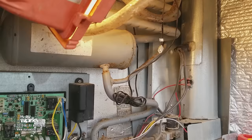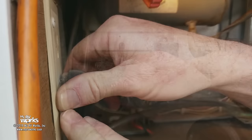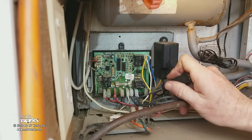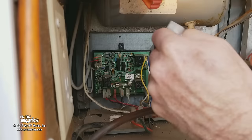Here's your heating element right up here — it's the one that goes in the boiler, and we're going to be pulling him out. But it all starts over here. These black wires that go to the heating element start from this control board. So we're going to unplug this. I like this little tool right here because I can reach behind these prongs and just pop this right off. So now I have my heating element loose.